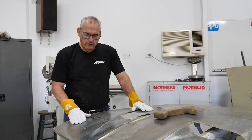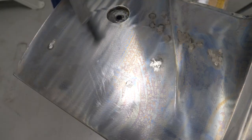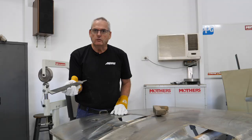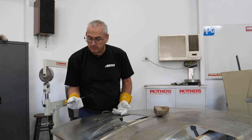This one's actually been deoxidined quite some time ago and then we've done the welds since, so you can see where it's been sanded up. I'm just going to run a file over these to find out what's low and what's high. I like to use TIG gloves - I get good feel with them, looks after my hands and fingernails. Two options here: one's a body file and one's a lathe file. This one's a lathe file - it's got just one cut, not cut both ways.